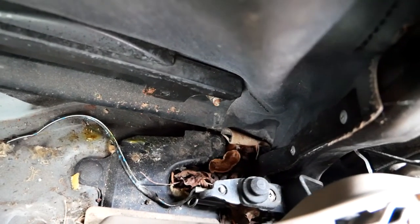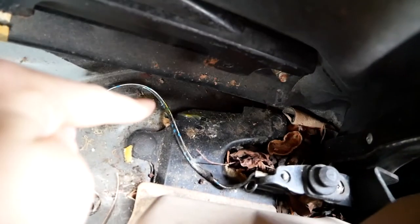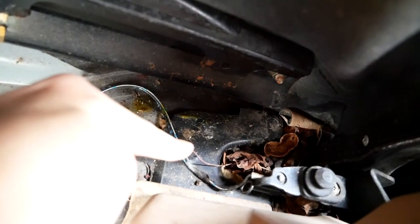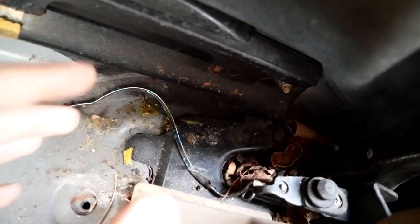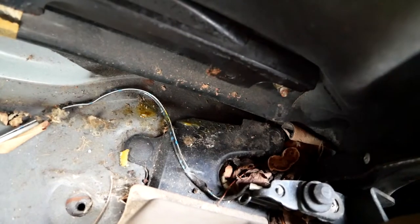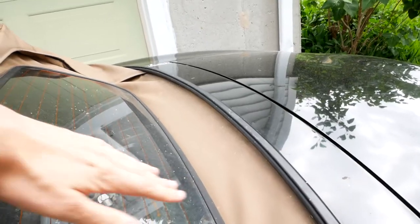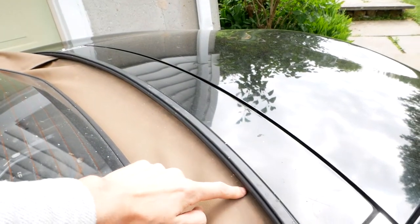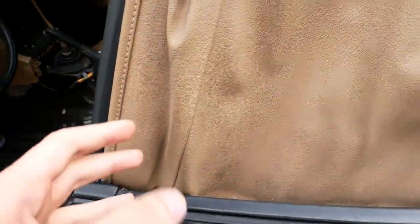The drains we need to clean are right here on the outside of the car at the end of your rain rail. The rain rail is this part here that runs along the bottom of the top which collects water — I'll show you from the outside. The drains are this plastic thing down here that are all filled up with some debris. When your top is all the way up and operating properly, water runs down it and into the rain rail which is right down here.